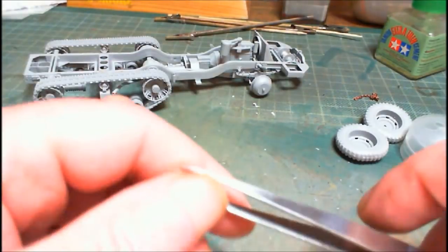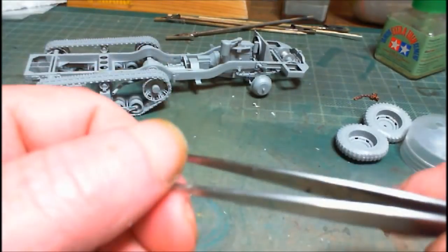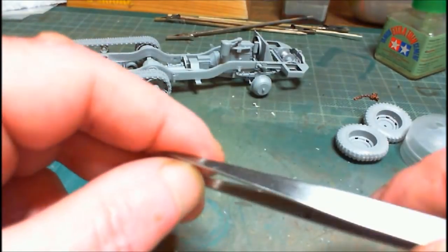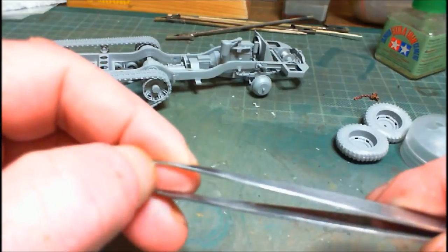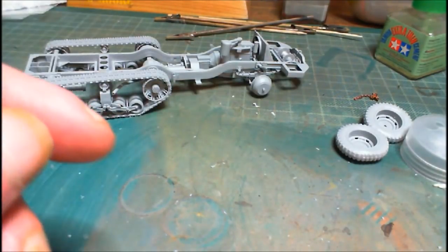But it's not like, say, in Europe, or certain places in America, that when it rusts up, it only gets so far. It doesn't get as deep. You don't get that kind of wet rust. It's a dry rust, and it just discolors everything, but puts a tiny little coating of rust on it. Eventually, if it's left alone, it will just eat away, but it's constantly being rubbed off again by the sand and the wind and all that kind of stuff, so it doesn't really dig in deep, and it doesn't get flaky rust. It's a surface rust.